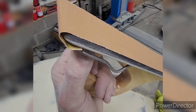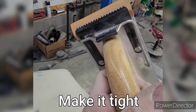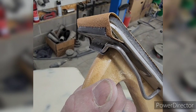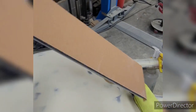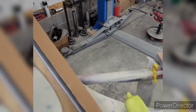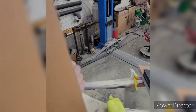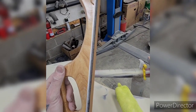When you put this paper on your hard file, you want to stretch all the slack out of it — make that paper fit into those teeth perfectly. Take your time, cut it with some scissors. I keep specific scissors in one specific toolbox just to cut the papers, and I'll keep an old piece in there so I get a good idea of how long to cut it. If you cut it perfectly and get the slack out, it'll stay on longer. I got that paper on there perfectly with no exposed foam — you don't want any exposed foam or the sanding dust will work its way behind the paper.